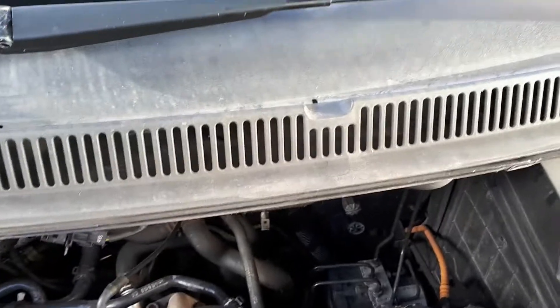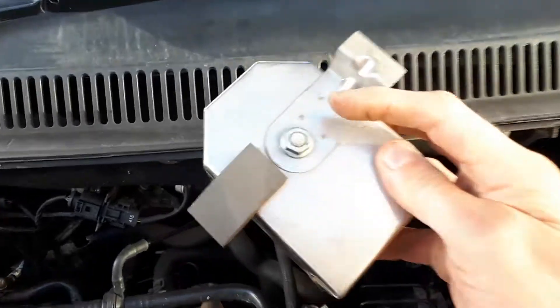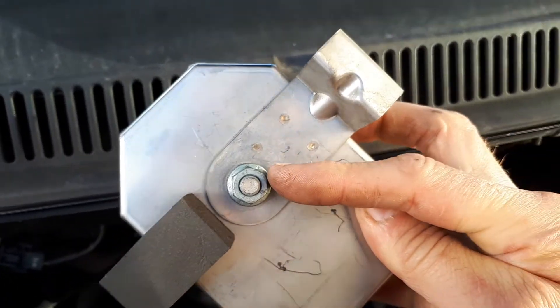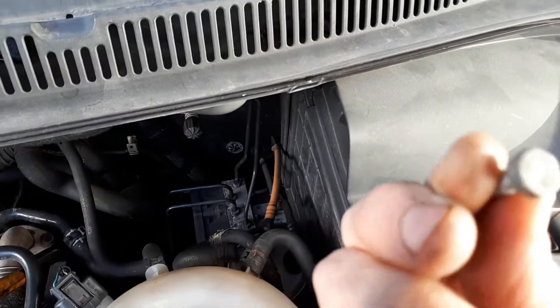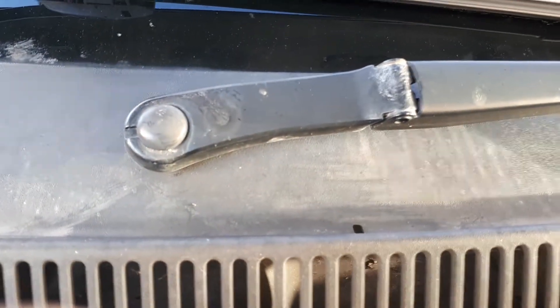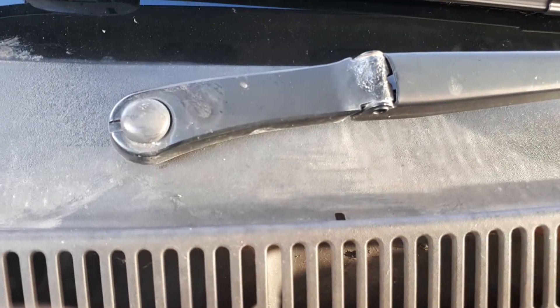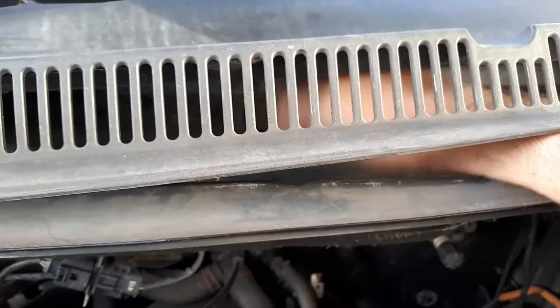This is the hard bit when you have one hand on the phone, but basically the klaxon unit is facing you underneath. You can see this 13mm nut here, and there's also a 10mm in this hole. There is enough room to reach in under here with your hand. You can try to take the windscreen wipers off, but they're on a tapered spline so removing them is very hard. I found that you could get in with your spanner and unturn it.